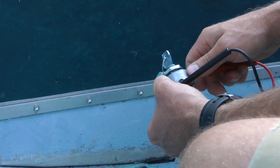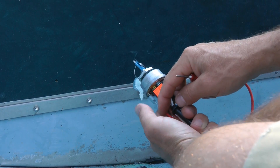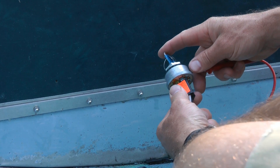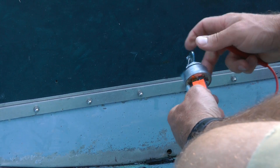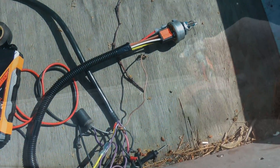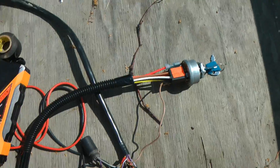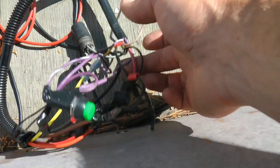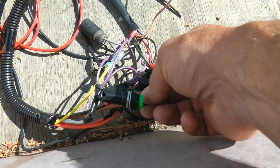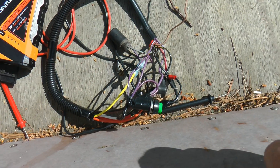So that's not your ground so much. The brown wire here — if I touch it to the body, it seems to always ground out. So that is going to be your ground. I'm trying to figure out what all the wires do here with my multimeter and getting it mated up to this wiring harness. It's just kind of all taped together right now. I need to get some terminal blocks and make it more permanent.